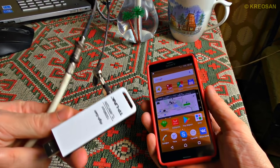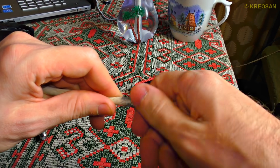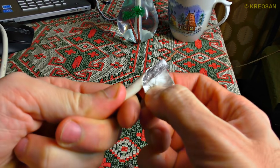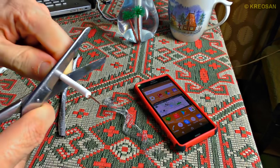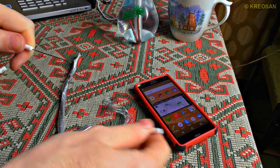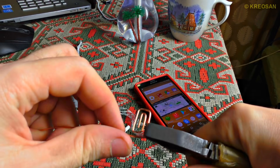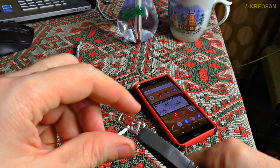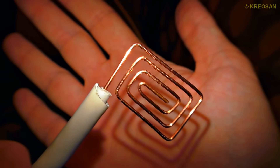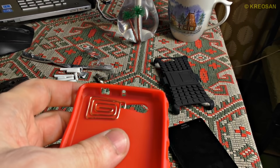But what about the smartphone — how to connect it to the Wi-Fi adapter if it hasn't got the right output? This is quite simple: you have to make a capacitive coupling of a Wi-Fi adapter and a smartphone. Strip the cable to this length, then spin it this way with the pliers. Put this zigzag close to the place where the antenna of the smartphone is — it's usually located in the upper or lower part. I use a plastic casing to fix it better so I can switch it off easily.